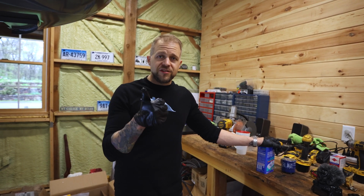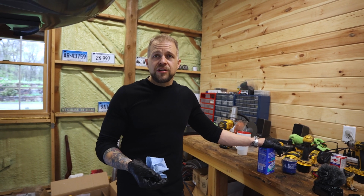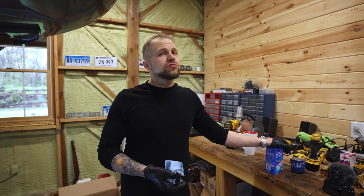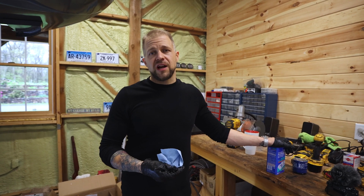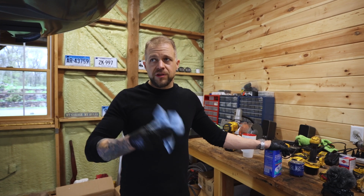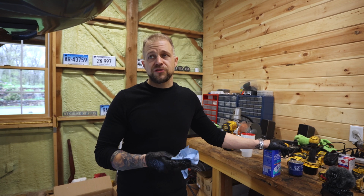Something that can, one, manage the heat, and two, provide sufficient grip. Now with that said, you don't need R compounds, you don't need Hoosiers for your track day. Any of the 200 to 300 treadwear class tires are usually more than sufficient for those duties, especially if you're a newer driver. You're not going to be pushing the car at the absolute limit where those tenths of a second matter the most. So just a decent tire compound, and having good heat management is most important.